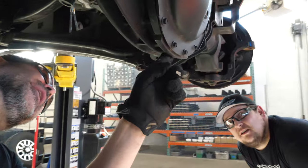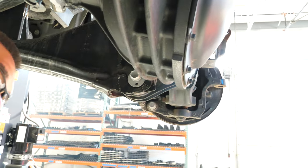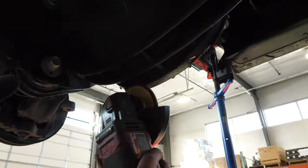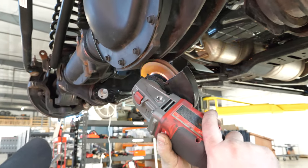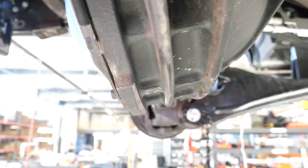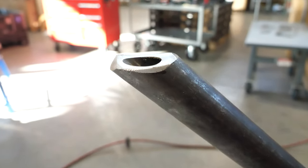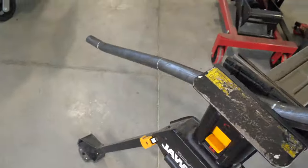Using the flap wheel, clean a little here and there just to take a little off the surface and sink the tube in just a hair. Remove a little more paint around the edges — that's going to let the tube sit into the differential just a little bit, giving more surface area without removing too much material. Just a slight cut to the end of the tube, probably about a sixteenth to an eighth of an inch off each end to make it fit a little better into the axle seat.